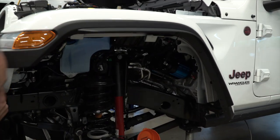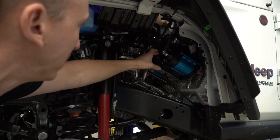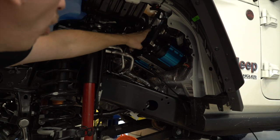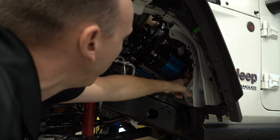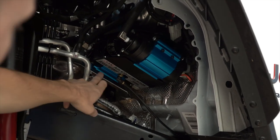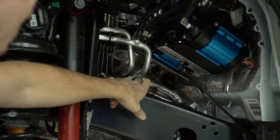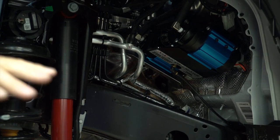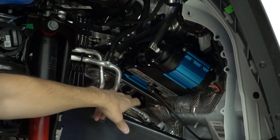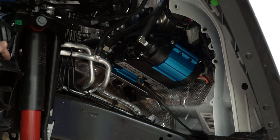As you can see, we've got the front inner fender well removed and we've got the mounting bracket all tucked up. It uses several different attachment points, hanging it off of the brake booster as well as on the firewall, so it is tucked up and secure. I really like this heat shield because the air compressor is mounted very close to the catalytic converter, which gets very hot, so it's got this air gap aluminum heat shield to protect the compressor from any heat throwing off that catalytic converter.